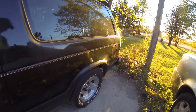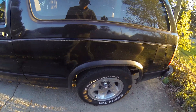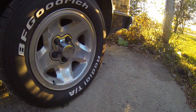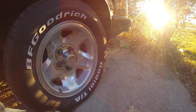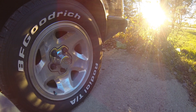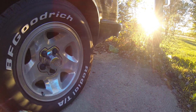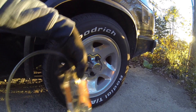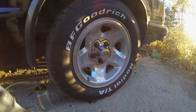I'm going to release a bleeder screw on the rear of the truck and drain the fluid into a jar. I usually take my knife and just make an X on the top of the lid — that's enough to jam a piece of tubing into, and that piece of tubing will sit down at the bottom of the jar while the other end fits over the bleeder screw.